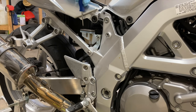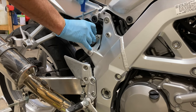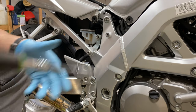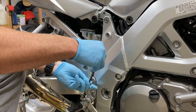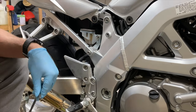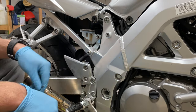I didn't bother looking up any torque specs when putting this back together, but I went around and made sure everything was tight — especially the brake lines. Because you have those crush washers, make sure you don't skimp on tightening those up because they can take a lot. The old one had been torqued down quite a bit and was hard to get off.